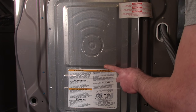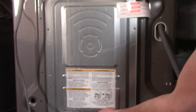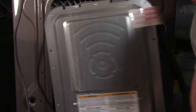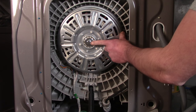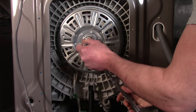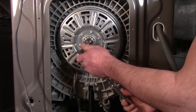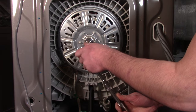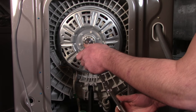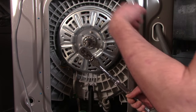The first step is to remove the back panel — just lift and pull the bottom out first. Next, remove the center bolt for the rotor using a 17mm socket. You'll notice the rotor moves when you turn the socket, so the trick is to give it a quick pop in the counterclockwise direction.